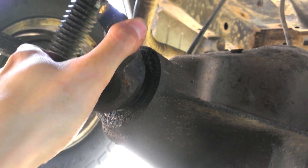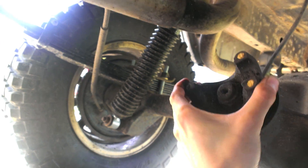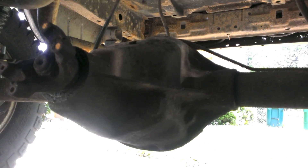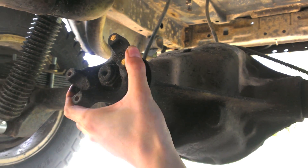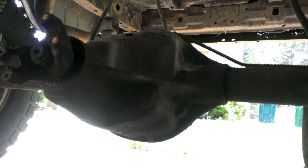As you can see there's play and in-out movement — my rear axle is shot. If you've been watching my videos, my Dana 30 front was doing this too, a lot worse. So I'm going to tear this whole thing apart, put all new bearings in, and I've got an e-locker going in there to lock the rear. It's an electrical selectable locker — three-pin design — so all I need to do is run a wire, no cables, no airlines.